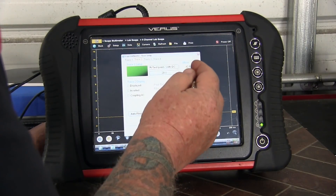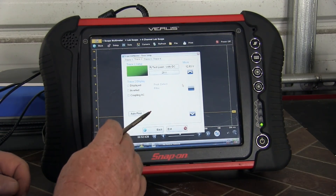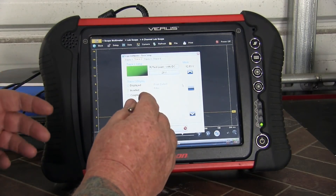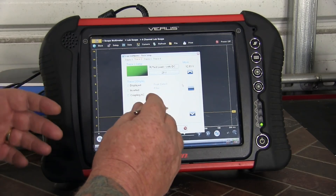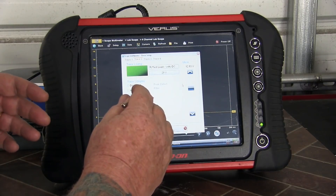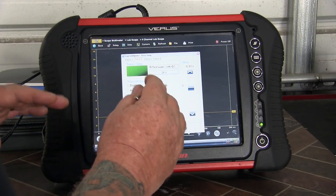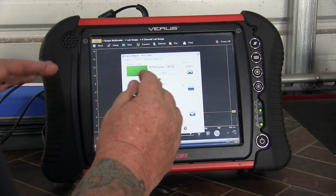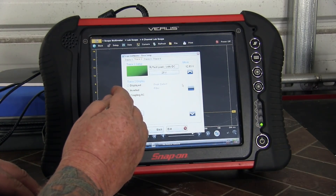I want to get my sound input on the second channel. Since we're using the pressure sensor, I don't really care about an actual voltage reading. In fact, I can't get one because the piezoelectric crystal reacts to changes — it doesn't physically measure the amount of pressure or voltage applied to it. So I'm not worried about that. Because I'm not worried about that, I want to keep it in a nice center of the screen, not worry about any DC component to the signal. So first I'm going to pick AC coupling.